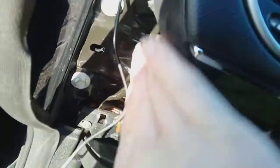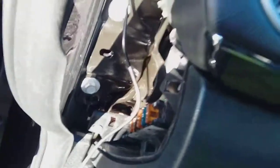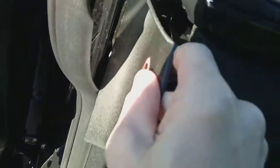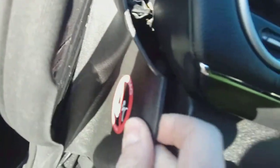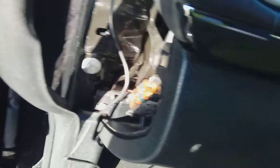The side cover on the dashboard is very simple to remove — it's designed to be accessible for fuses. It sits on little spring clips underneath. Open your glove box, put your plastic scraper behind it, and it just pings off. It hooks at the rear, so it slides in and pops off at the front first. The owner's handbook also tells you how to remove it — very straightforward.